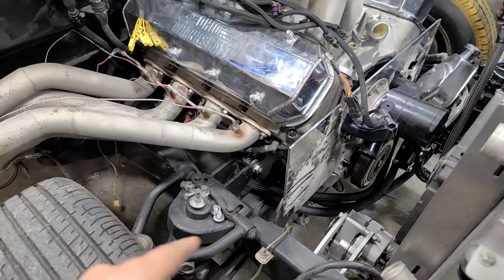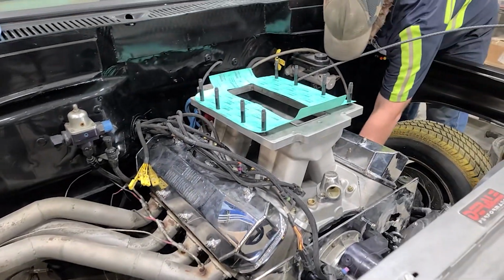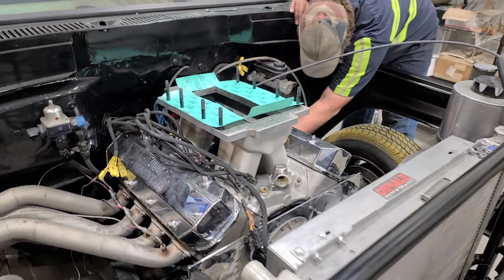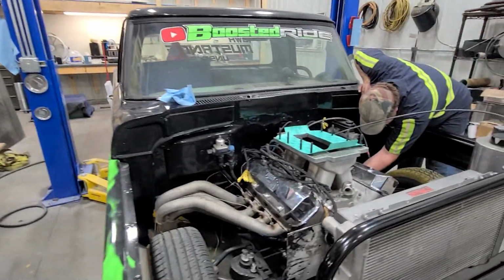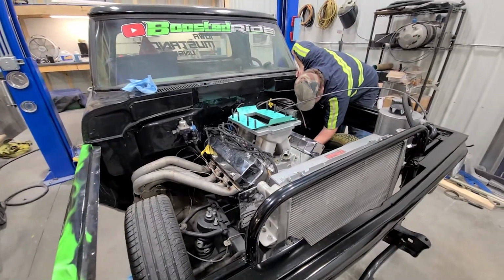But he did get maybe a couple things done. Got the plugs gapped. Wires are on this side. Wires got to get on the other side. Plugs are all in. Passenger header's on. He also went ahead and got the adapter plate bolted on. We screwed the studs in there, and while he's here, we're going to go ahead now. The blower is sitting way back on the bench. So we're going to get that brought over here so I can have his help putting that up on there, and then we could drool all over it.